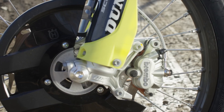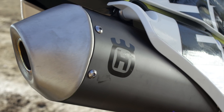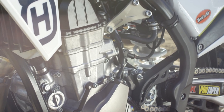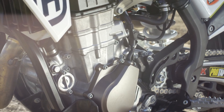Same thing coming off the back — the way they've positioned the exhaust and done the airbox, they've just tried to make it so those side plates don't get wide until the last possible second. I ride more middle to front of the bike, so I can't really comment on the improvement in the rear, but from the center of the foot pegs up to around the front of the fuel tank I definitely noticed a good improvement. It made me more confident getting out over the front of the bike, getting my knees forward — mostly because I almost didn't realize I was that far forward because it stayed skinny so long before it tapered out.